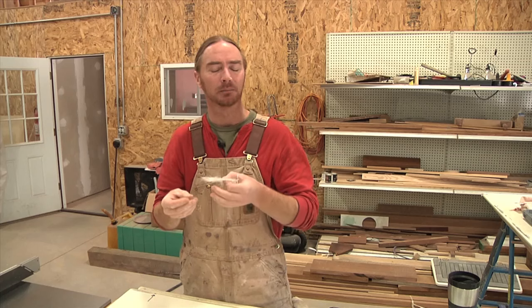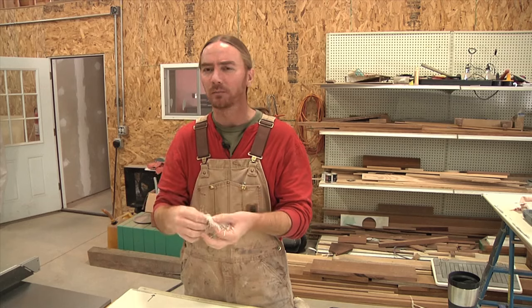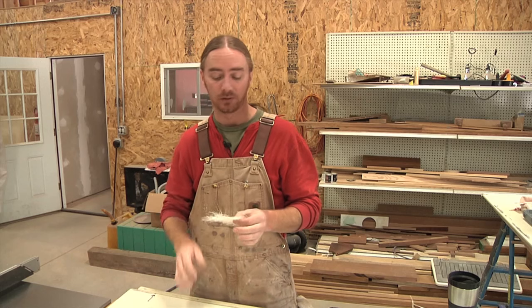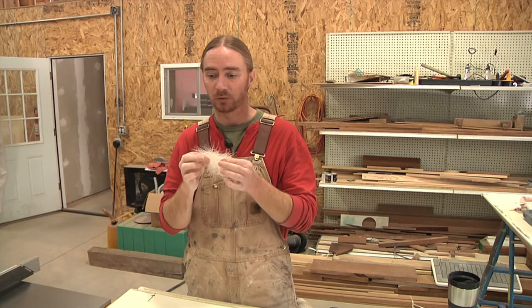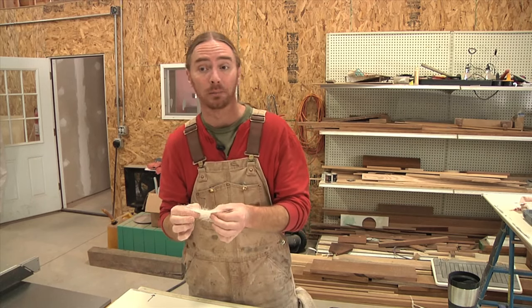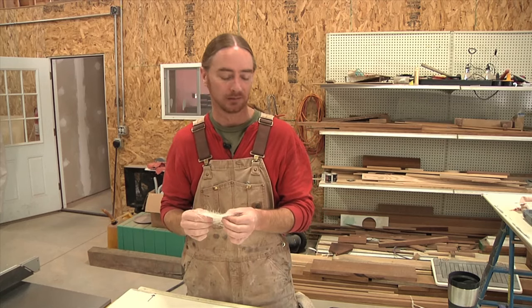Those binders become suspended in the epoxy, and it doesn't conform to the curves and radiuses quite as easily. However, because we're working with a flat surface here, that's really a non-issue. It's reinforcement. It will still cure within the epoxy, and it's going to add the strength that we're looking for to prevent that hole plug from being able to pop out.